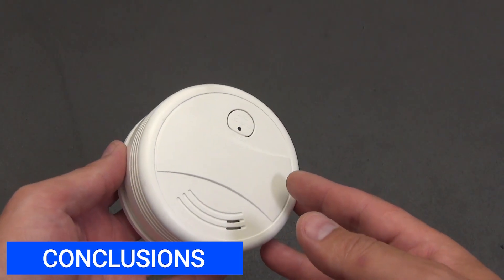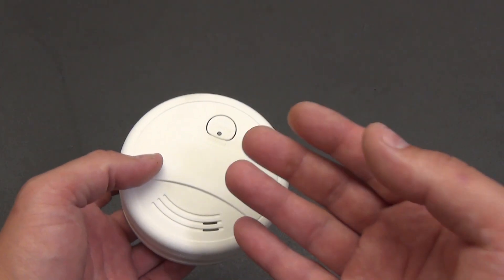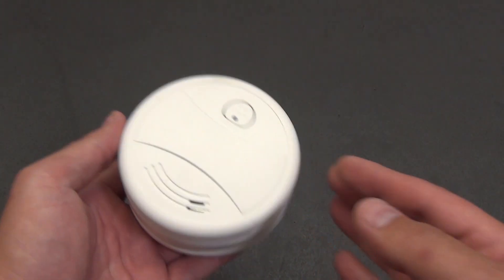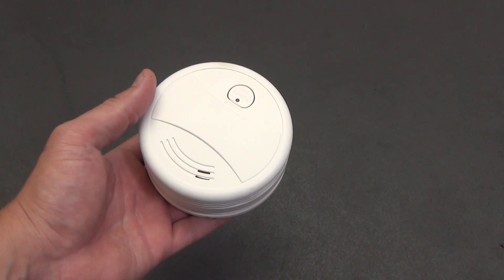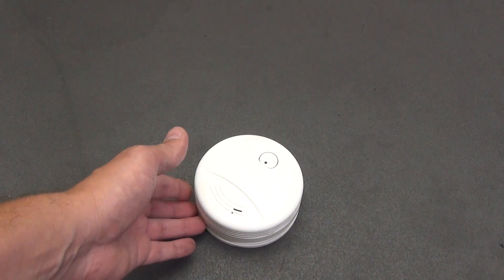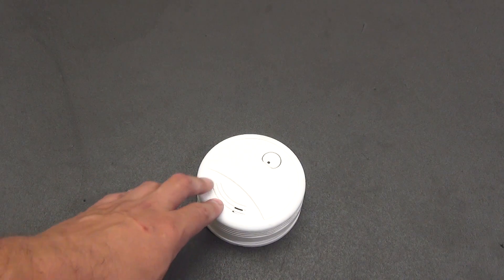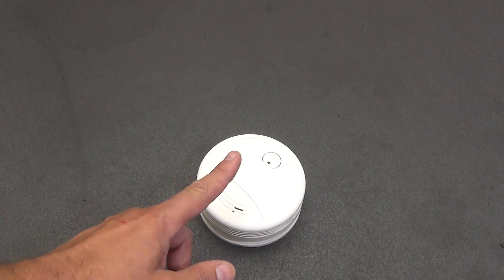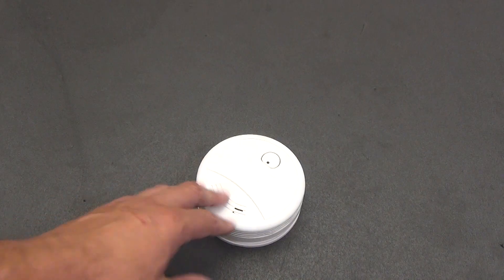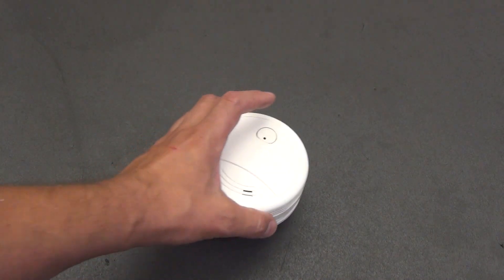This is a simple and straightforward household smoke detector with a built-in siren and integration with Tuya/Smart Life that covers the main task: give a loud on-site alert and immediately send a notification to the phone. Installation and connection don't require any fuss — mount it on the ceiling, insert a Krona, hold the button for pairing, and everything's ready. The siren really attracts attention. The status indication is readable without a manual. The app has an event history and basic if-automations — turn on a light, send a message, start recording on a camera, and on release, neatly return everything back. Wi-Fi is appropriate here if the router and internet are powered by a UPS. The local siren remains autonomous and will trigger even without a network. As an executor the detector can only enable silent mode — you cannot sound the siren remotely, which is logical so the critical function doesn't depend on external conditions. Power from a 9V battery is not a record for autonomy, but the app has an indicator and a low charge warning, so keeping a spare battery is normal practice.